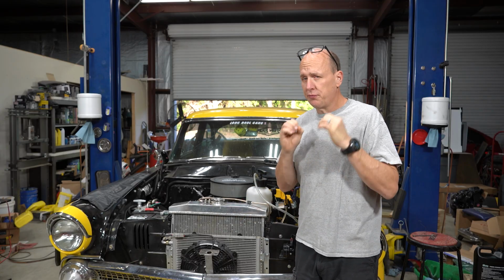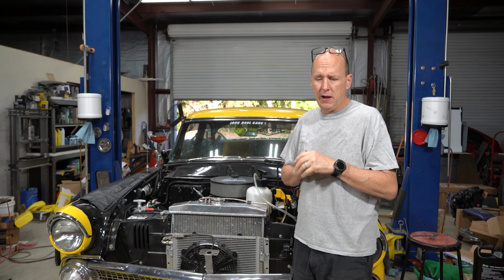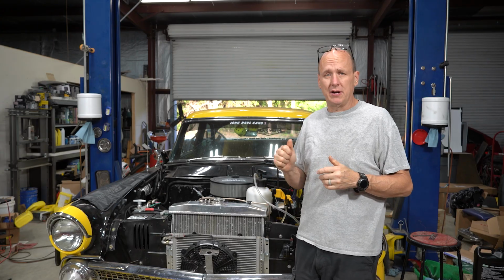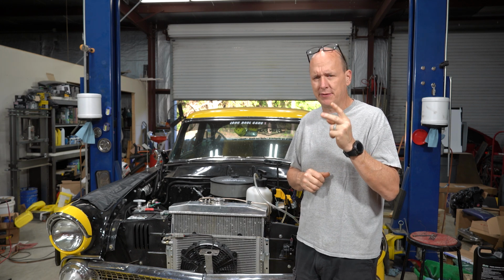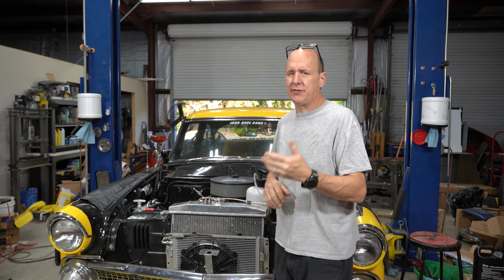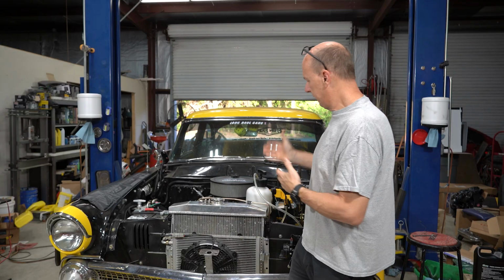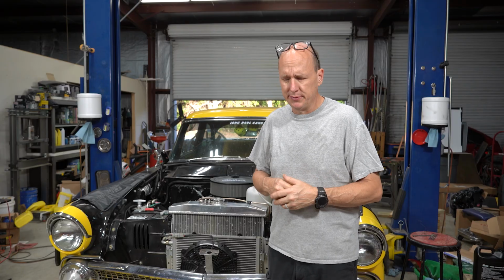The car has no spark plugs because, as I was instructed by the engine builder, I am to, without the spark plugs being in, crank the car for 2 minutes. Seems excessively bad for my starter, but it's to circulate the oil, which I did actually do with a drill prior to stabbing the distributor. I will still do a little bit of a dry crank.